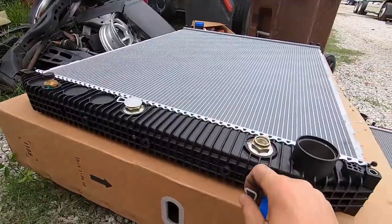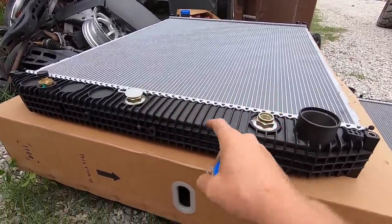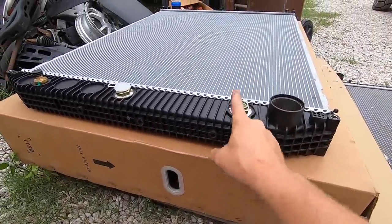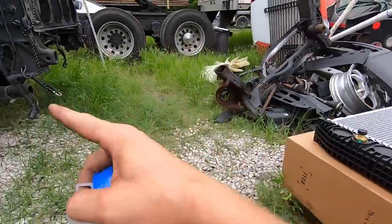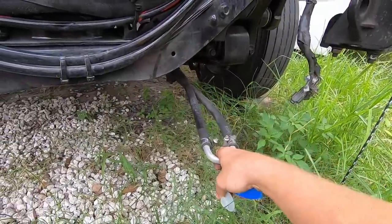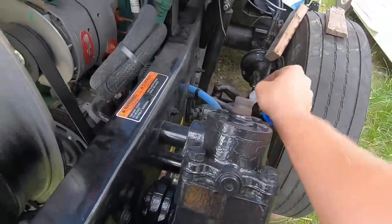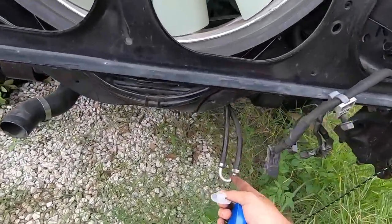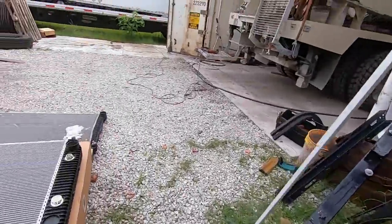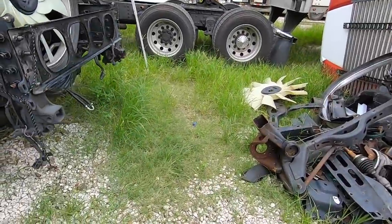Also, I know you guys are wondering about these little holes right here. In the aftermarket version, it comes with this little cooler inside here. It could be used for power steering cooler, transmission cooler — pretty much anything you want. And lucky for me, I actually have a hose coming out of here. I thought it was a transmission cooler but it is not — it's rerouted all the way back here for the power steering. I'm going to go ahead and attach these hoses to these little fittings.